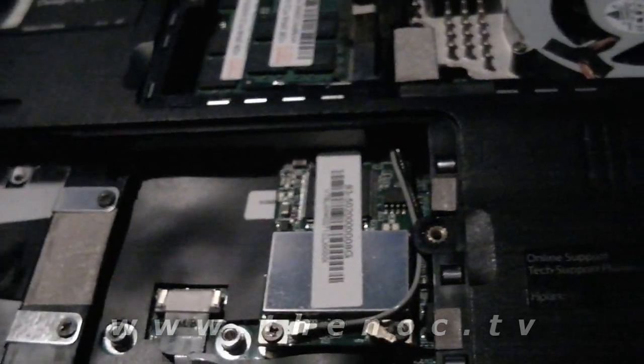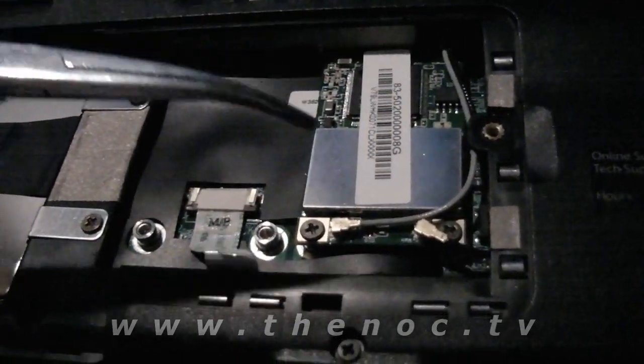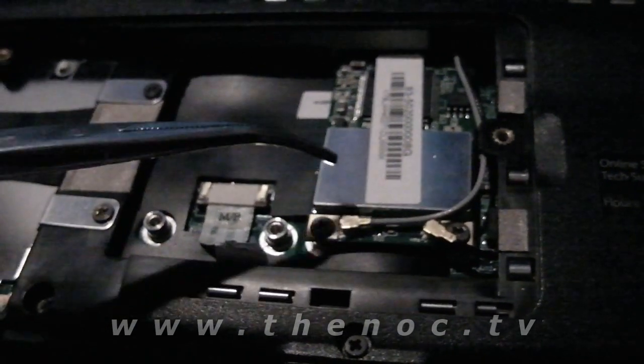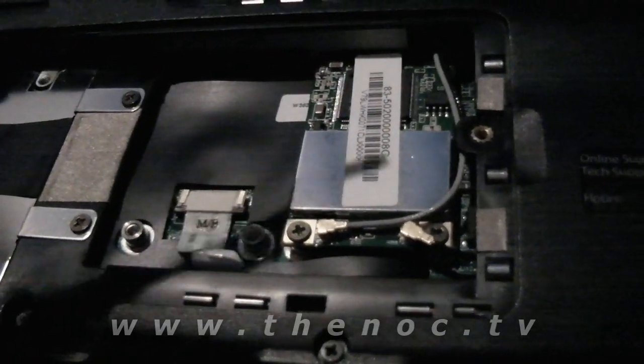Usually with a pair of forceps, you can go through, get a click onto them and kind of just wiggle them up and pop them straight up. If you try and pry them up with a screwdriver, you can break them. That's why I like grabbing hold of them with the forceps and going straight up with them. Usually keeps them intact pretty well.